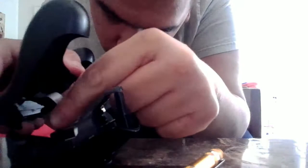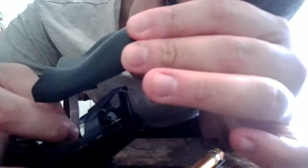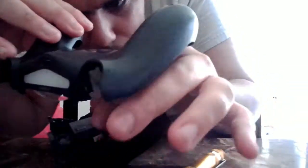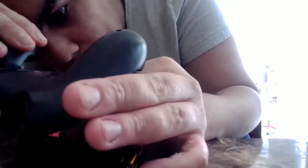So what you need to do is carefully hold with one hand and then use the other hand to instantaneously plug it in. Sometimes you can use tweezers, but tweezers can break these, so I recommend using just your hands. It's way easier, and you'll have a 10 times better chance of not breaking your controller. Try to even out the ribbon, because if you don't align it, you can instantly break it, and you're going to have to buy another one. Not necessarily, if you don't break your ribbons.